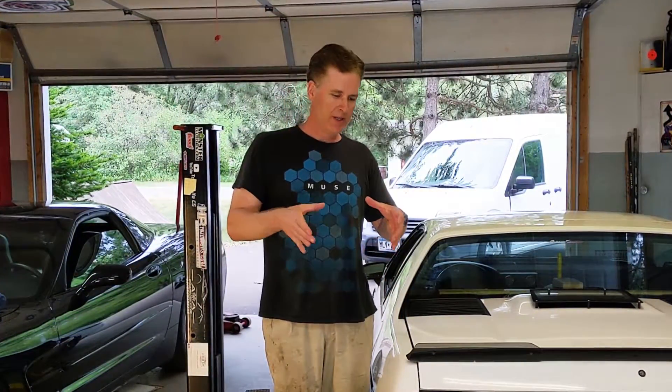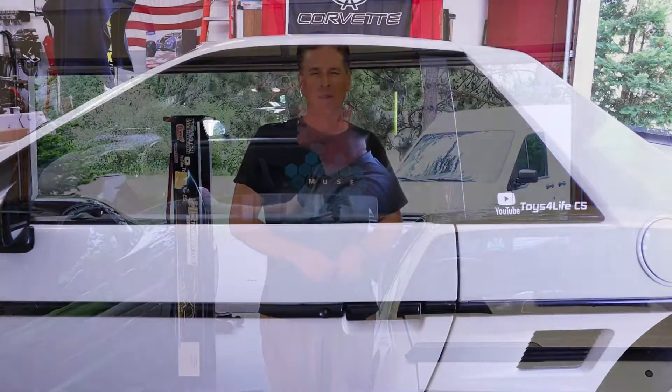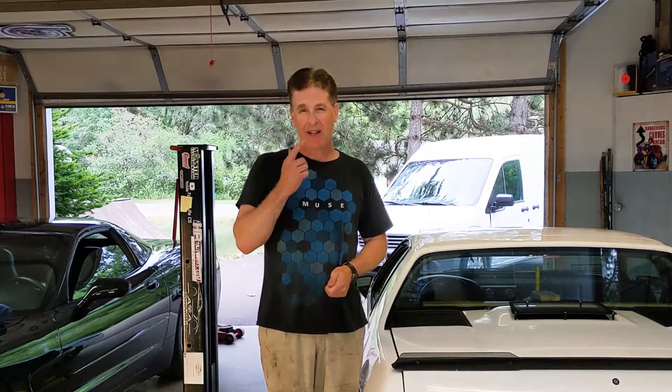Welcome back. When I was working on the last video I noticed on the ground as I moved the Fiero a puddle about like that. The smell test confirmed that it's gas, so the Fiero is out of commission until we figure out where that's coming from. Let's get it up on the lift, cycle the key a few times which will activate the fuel pump and see if we can conclusively determine where it's leaking.